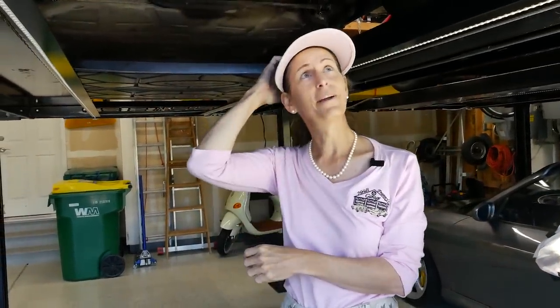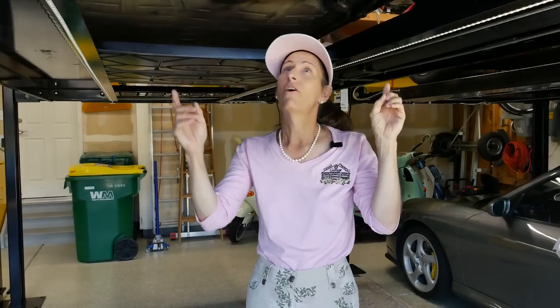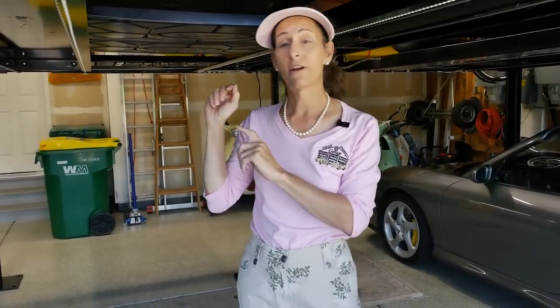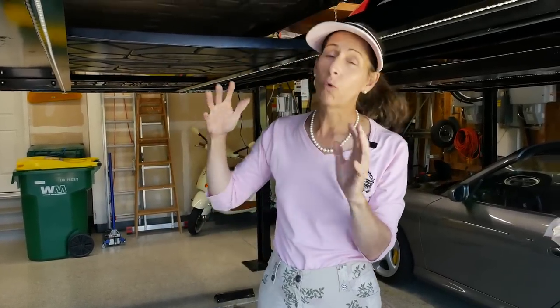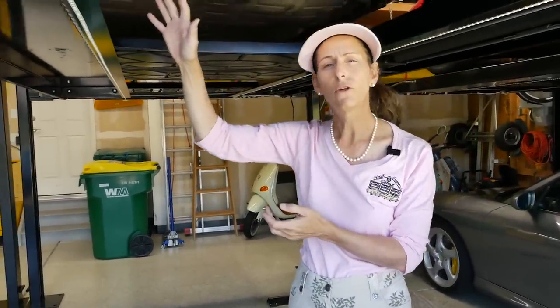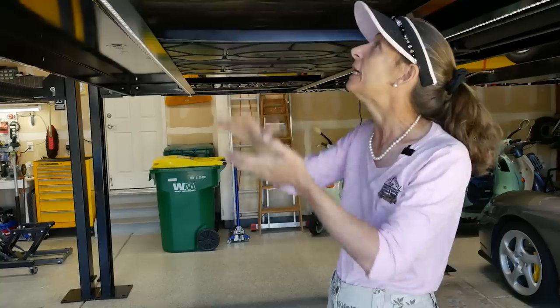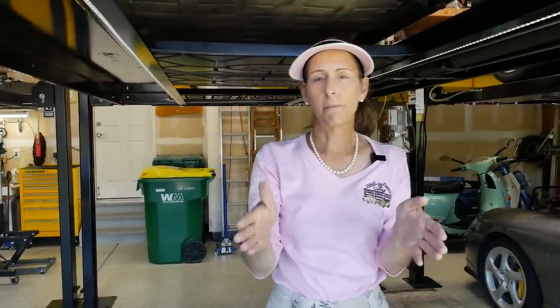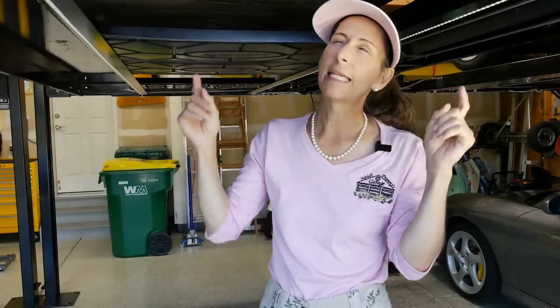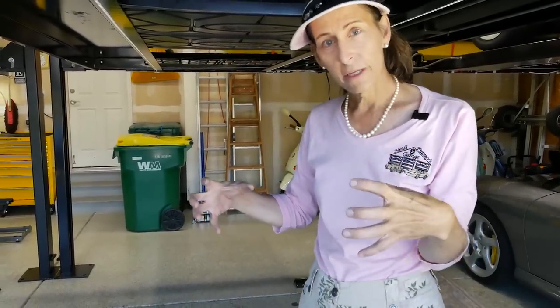Every night I'm up here looking at this going, how am I going to do this? If you've got questions, comments, or thoughts, go ahead and put them in the comments below — that would be super helpful because I have never done this before. This is the first time for me. I've had the engine out on the 356 several times and it's quite easy, but this is more complicated and we're pulling the transmission as well. We're going to remove our sway bar, electrical connections, fuel connections, throttle linkages, the heating system connections — all that stuff has to be disconnected. I'm going to spend about a week just disconnecting stuff, empty the gas tank, get it prepped, then bring Doug in and figure out an interesting way to drop it.